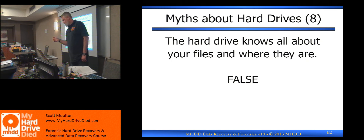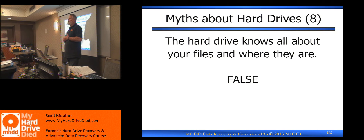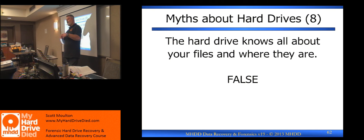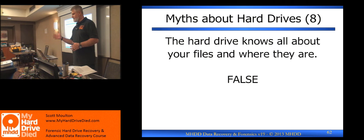On the bottom of page 72, I put the formula: LBA equals cylinders times heads times sectors per track. This is the actual formula to show that logical block addressing is still a variation of cylinders, heads, and sectors — the way it was on the first hard drives. When they finally went to logical block addressing, they just used a calculation from cylinders, heads, and sectors. But they now involve something called a zone table, which breaks content up into football fields on the hard drive.